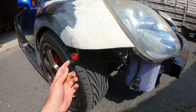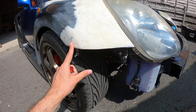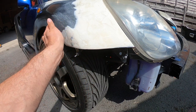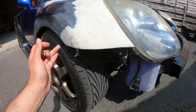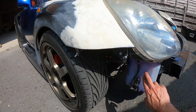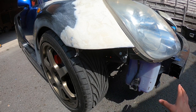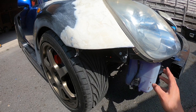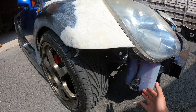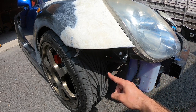To fit the quick release button I fabricated a bracket and then riveted that to the body panel. I then adjusted the bracket so the bumper is kept in line. Down here you'll notice there's no big chunky box of metal protecting this — I decided that was a terrible idea and threw it away. Instead I found a piece of PPF by 3M which protects and wraps all the way around. A knife is going to struggle to get through that, so it will protect very nicely from anything being thrown up off the wheel.